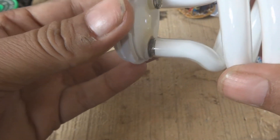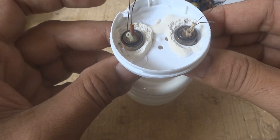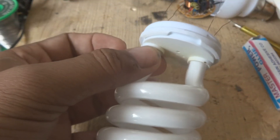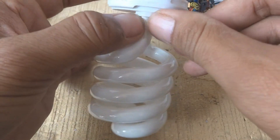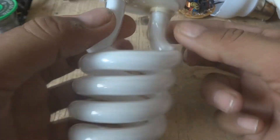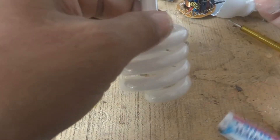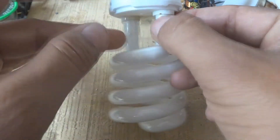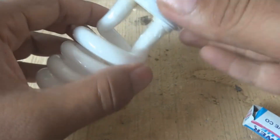These four fiberglass sleeves I am reusing. We are going to put the new tube in - it should just barely come out of the cover, not too much. If it sticks out too far the circuit will not fit back in. It should just barely come through. Then secure it temporarily using two pieces of scotch tape or insulation tape, fixing it in place. Do the same with the other leg using another piece of tape.